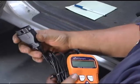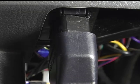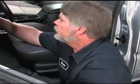Let's go ahead and connect our code reader. Now we have the OBD2 scanner connected. Something else to mention, if this was an OBD1 vehicle, the diagnostic port could be several different places, including under the hood. With the scanner connected, the next step, we want to go ahead and turn on the ignition. You don't want to start the vehicle, just turn it on. That'll give the scanner a chance to communicate to the onboard computer.